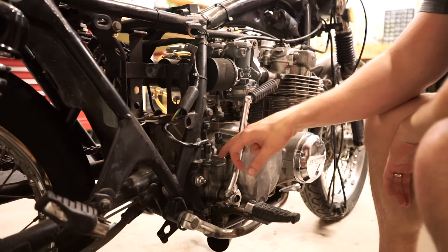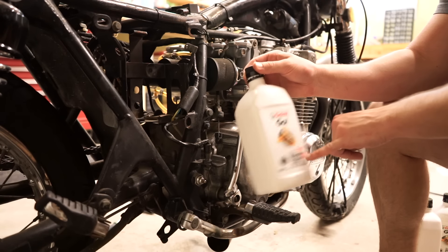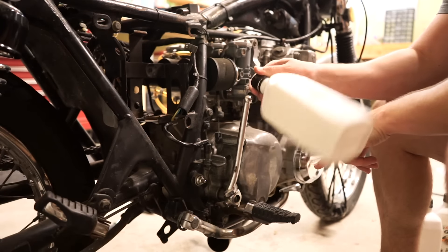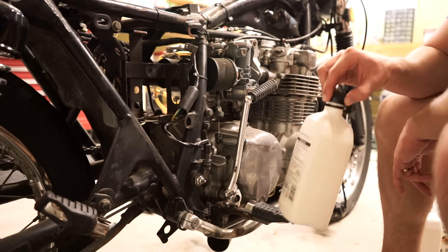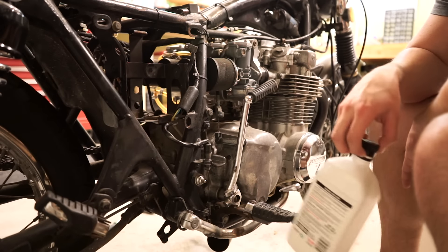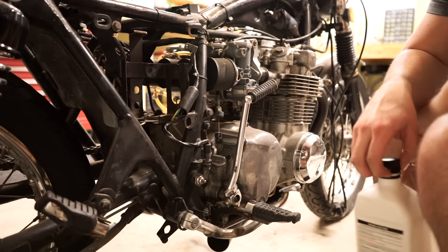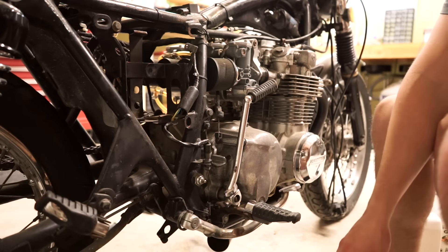We got three quarts in here. Like I mentioned earlier, I use Castrol 10W-40 motorcycle oil - 10W-40 is good for pretty much all temperature ranges, so that's typically what I stick with. I don't really have any brand loyalty to Castrol, it's just kind of what I've always used. I put three quarts in - the book does call for 3.2, but there's going to be some residual oil left in the bike so you're not going to get 100% out. I'd rather it be a little bit low and add some than have to worry about it being overfilled.